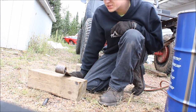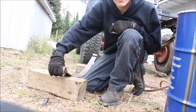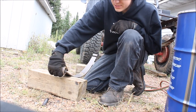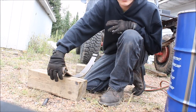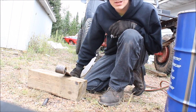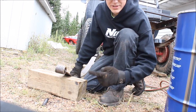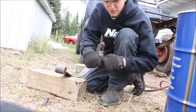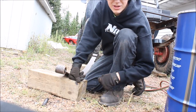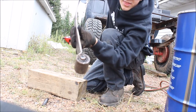When you just get done taking your leaf springs out of a vehicle — I don't know what it's like in other states, but I'm from Wisconsin and Wisconsin puts a ton of salt on the road, so salt equals rust. What happens is when you want to take leaf springs off an old vehicle, they're always rotted in. The bolt is always rotted to that bushing around it so it doesn't come out. You get the nut off and you think the bolt will come out, then you beat it with a hammer and it doesn't move. So you have to torch the bolt off on each side and you end up with a big globbery mess like this.